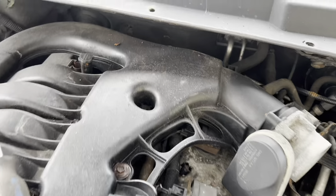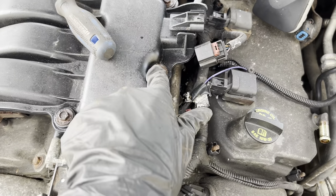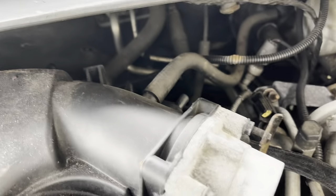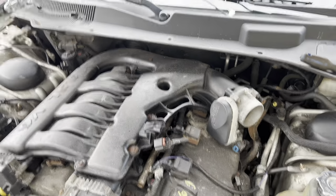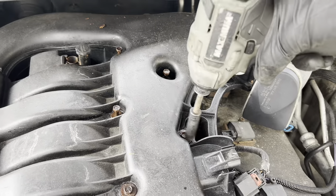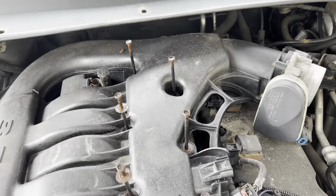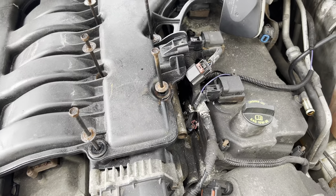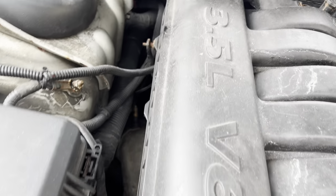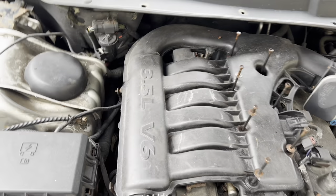Now we have more room to lift the intake out. I'm going to take all these 10-millimeter bolts out and definitely remove this hose — all the hoses in the back are now removed. Once you get all those bolts loose, it helps to stand them all up so they don't get caught as you pull the manifold forward out of the pipe. Make sure the studs on both sides clear, and then lift it out of place.